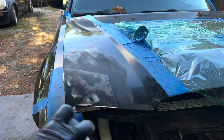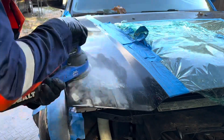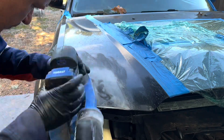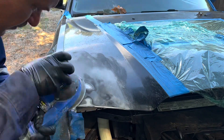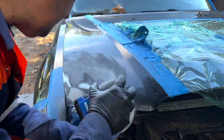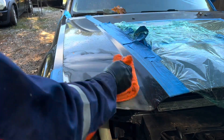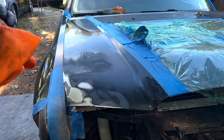I need to explain something. As you can see, I'm starting to remove this primer right here on this hood — this is the very beginning of my day. Unfortunately, even though it has been sitting for 3 days, the primer that I first used, which was primer with paint — I'll show you the bottle a little bit later — it started curling up all the paint.